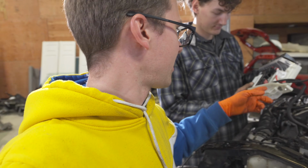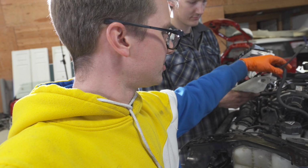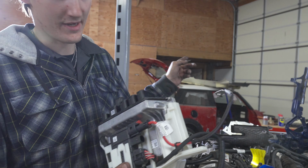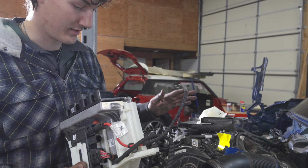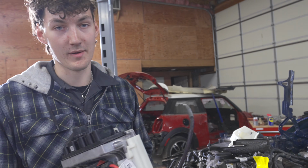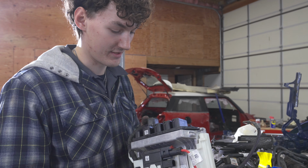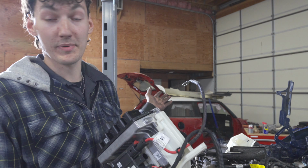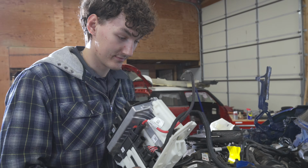It's in. Up next comes the ECU, as well as, I think, a fuel system control module in here. It's all hooked up. This is the one from the other Red Mini. This is obviously meant for a 4-cylinder. It's important that it be the 4-cylinder, and it also isn't going to be looking for an automatic transmission module. I'll make sure that's not there because it's a manual transmission, doesn't have the same thing, and it's apparently tuned with the JCW tune, so that'll sound great.